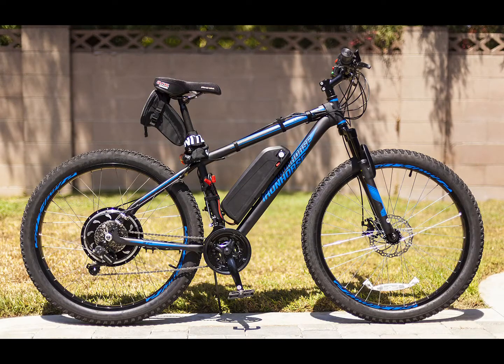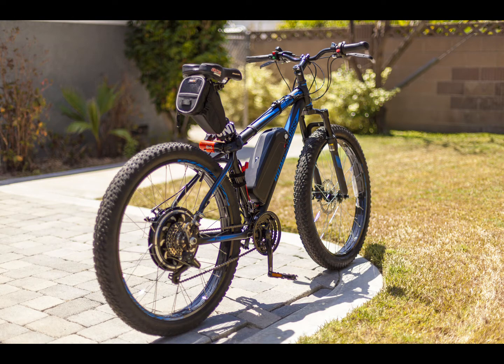In summary, the bike is better than I expected. Of all the kits I looked at, the Golden Motor has the cleanest wiring setup — having the controller inside the hub makes a big difference. It's super quiet, has more power than I anticipated, and I'm totally happy with the 500W version for flat riding. Total cost breakdown: $390 battery, $450 Golden Motor, $179 bike, ~$100–150 in miscellaneous parts — you're looking at around $1,200 all in. Hopefully this gives you some ideas for your own builds.